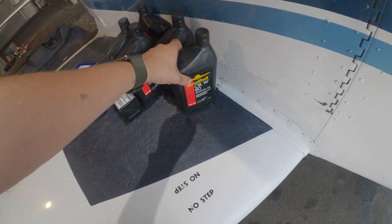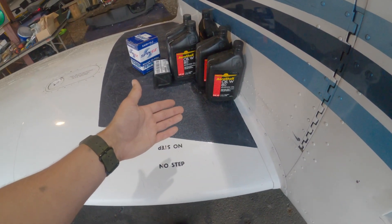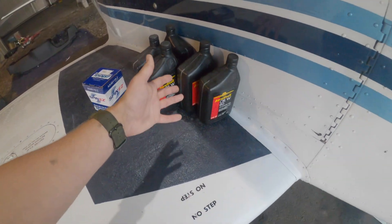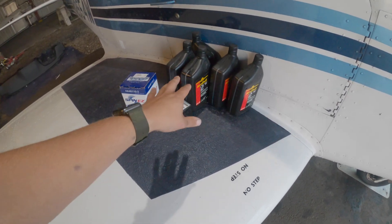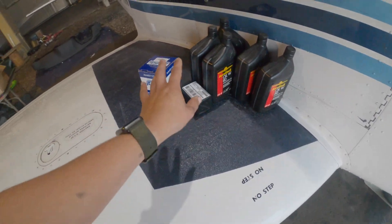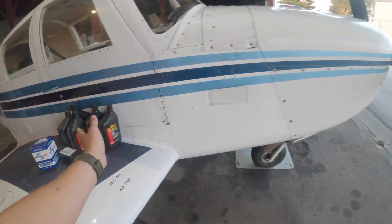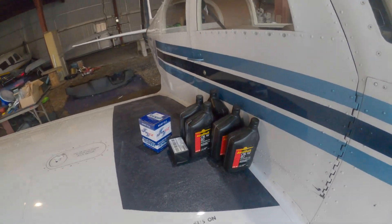And then I'm just using some W80 that I have lying around. We're getting towards fall and the weather's getting a little better. Lycoming says you can use this stuff between 30 degrees and I believe it's 80 or 90 degrees, and that's pretty much where the weather's been. So we're just going to use it up before winter hits. Other than that, I usually run 20-50, but I just want to get rid of this stuff — it's from my last plane and I want to stick with 20-50 from now on. So I'm just going to pull the plane out, run the engine up, get the oil a little bit more stirred up and warm so it drains out easier.